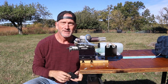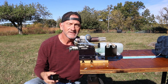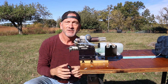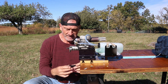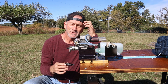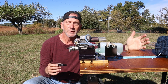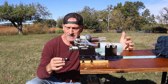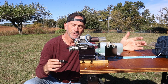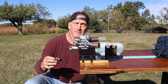So that was incredibly interesting. The first run with this setup — not that plug, that Chinese OS number 8 plug — it only had about 5 runs total on it before that, if even. Counterfeit Chinese number 8 plug. I saw a peak of 13,830. I'll have to check the video if it was actually holding that. Then I swapped the tanks, left the plug the same, put the 5% fuel with caster in it. Obviously I expected lower RPM, but it just didn't sound right the whole time — surging and all that. I wonder if during that run the plug was going. I think it was on its way out during that entire run.